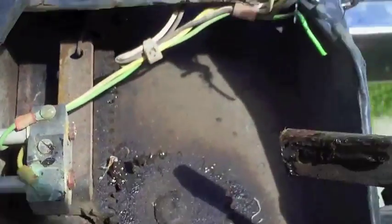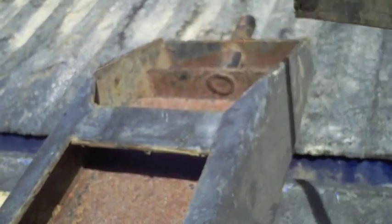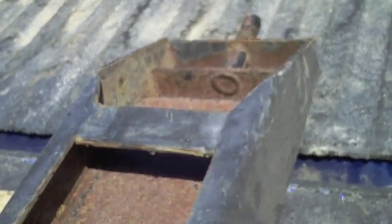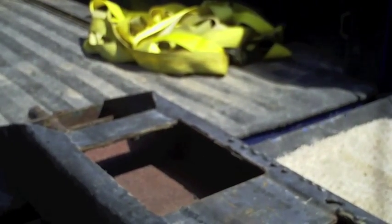While you're down here, look at the load-bearing surfaces of your hitch. This one you can see is getting really pretty rusted, but I don't see any cracking on the welds and I don't see any cracking on any of the gussets. This would be considered a 10,000 pound hitch, so if you have an 8 or 15, they're going to be slightly different.